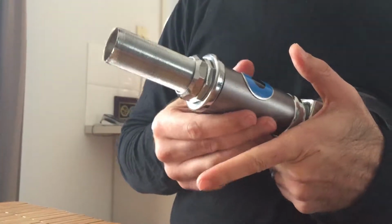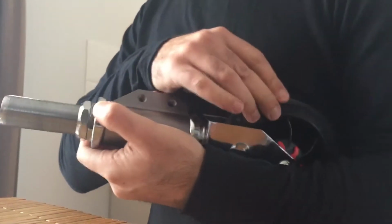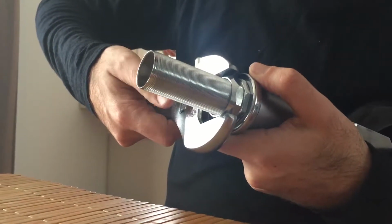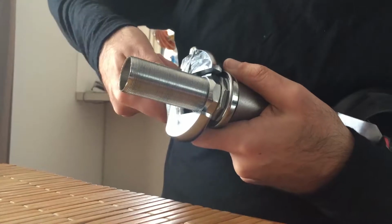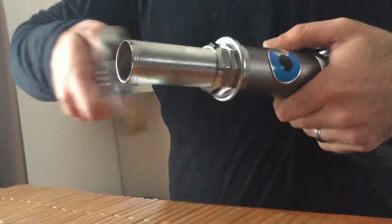That's really good, and no vertical movement. Right, so tighten as hard as you can with your finger so that this doesn't rotate. Make sure you've got this sitting in here so that the whole thing doesn't turn. Then with the wrench, like, come on, fiddly work. I hate fiddly work. There we go. Tighten it up. As hard as you can. So still lots of rotation there, but no vertical movement. Nice and tight. So that's not going to loosen up as you steer. And now you're ready to assemble it.